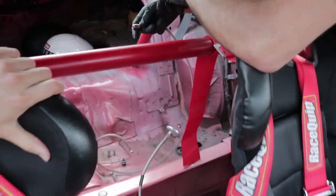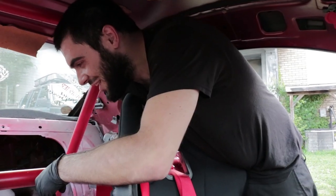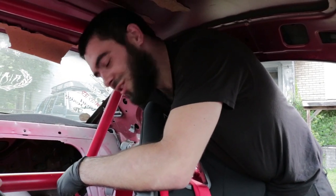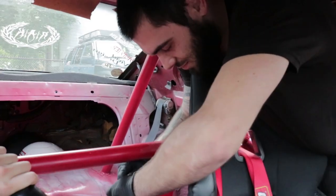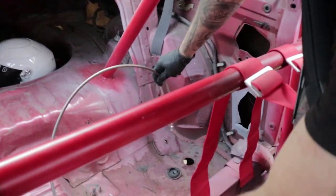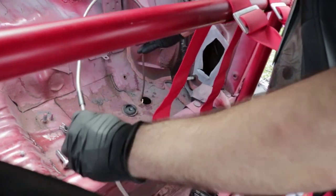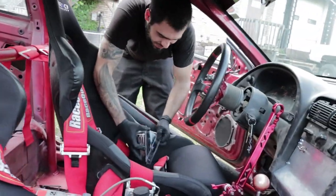Now this applies to SN95 Mustangs, since this is what I have. Conveniently enough, there are drain holes under the rear seat and they go right to the calipers, which is quite amazing. We're just gonna run those here on the T fitting, right down those little holes, and eventually you'll come out in the ground. Look at that. And then you repeat for the opposite side.